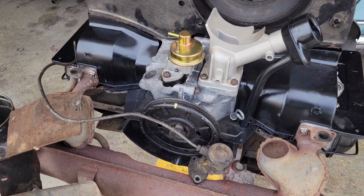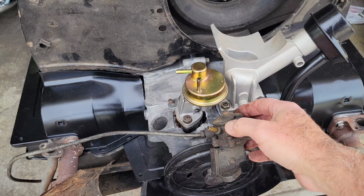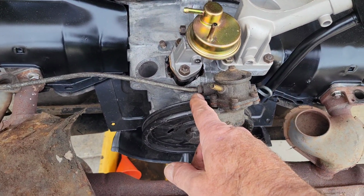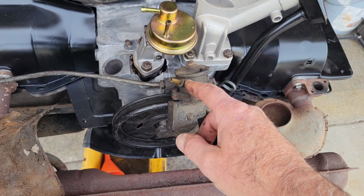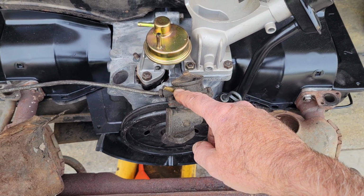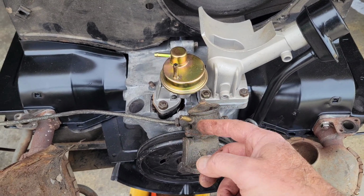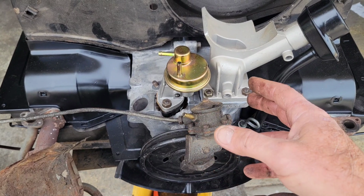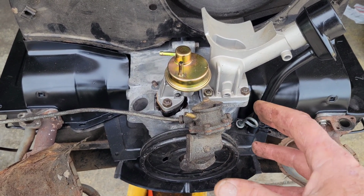So other things that were kind of weird about the Bastard 40 horse is this is a little bit later year fuel pump. But if you notice, it's threaded here on this end, okay, and it had the line connected to it. That was the Bastard 40, but they looked very different. I can't remember exactly what they looked like, but the fuel line on them went straight up like that one, okay? It went straight up. And some of them were bent. I don't remember exactly. Had a factory bend in them. The bus ones were a little different than the Beetle, I think, but they had unique things like that.